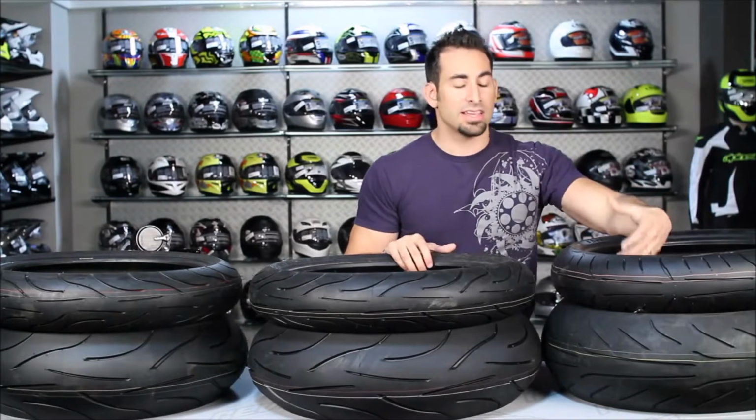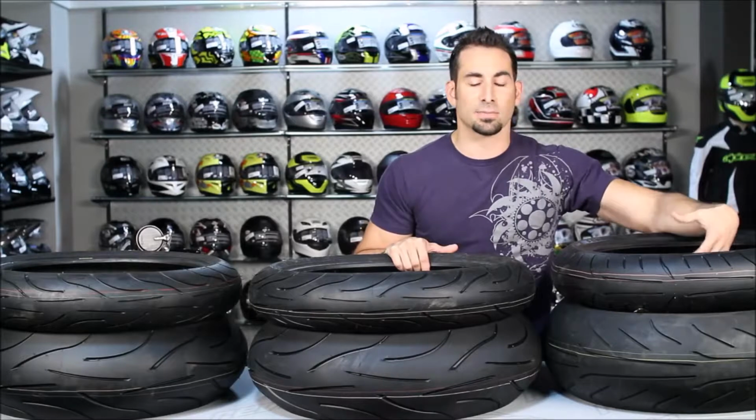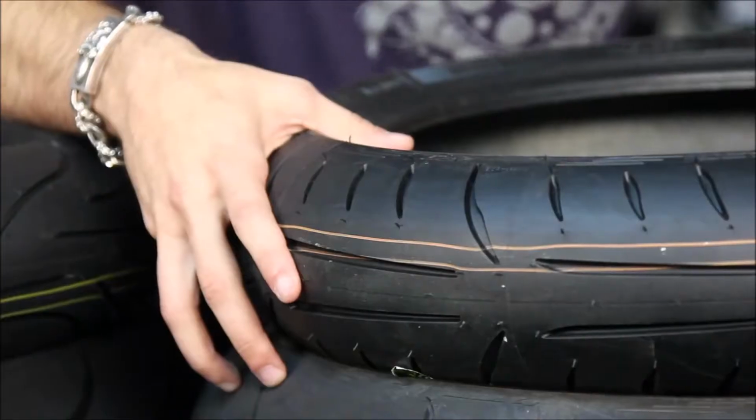We don't have a dramatically different tread pattern. It's really not going to perform that well. And this is my opinion. I think that when you start to get into a much more contact patch-oriented, lighter weight tread pattern, meaning you're going to get more surface, you're going to have less ability to eject water. So again, it's still dual compound technology. The compound of the tire itself changes.